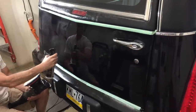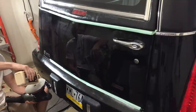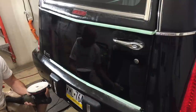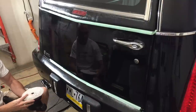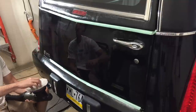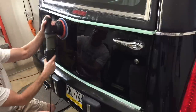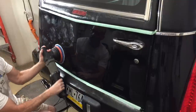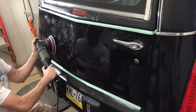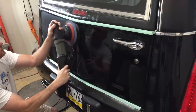One more quick area I want to scrutinize - back here we have a lot of love marks that are straight across and rather deep. I'm not positive it went through a car wash, but the pattern is similar to what a car wash makes - the wraps that go around the front and rear of the vehicle. We're going to remove that with a long-throw polisher because, thankfully, this back gate is flat and large. We'll use the Lake Country pad, QED sprayed on the panel, and the M105, and we'll get it done.